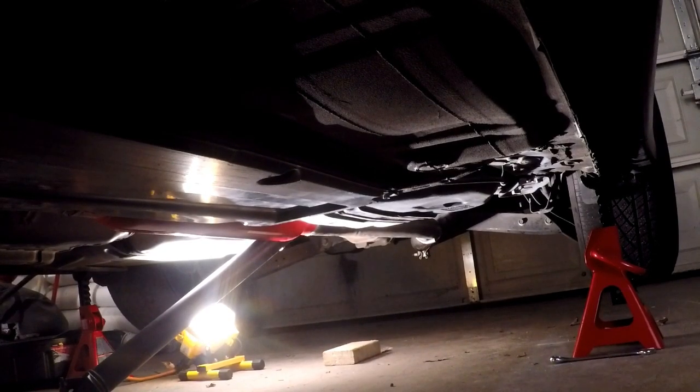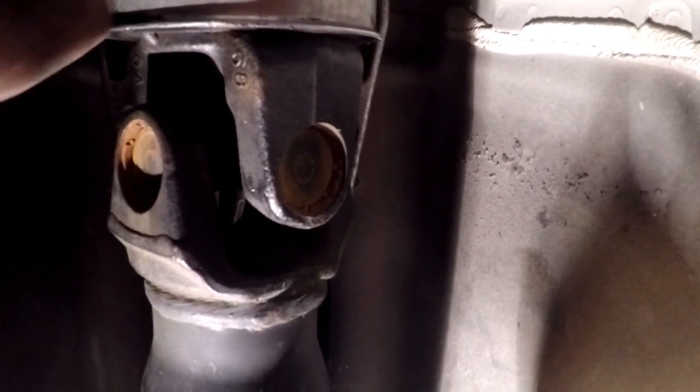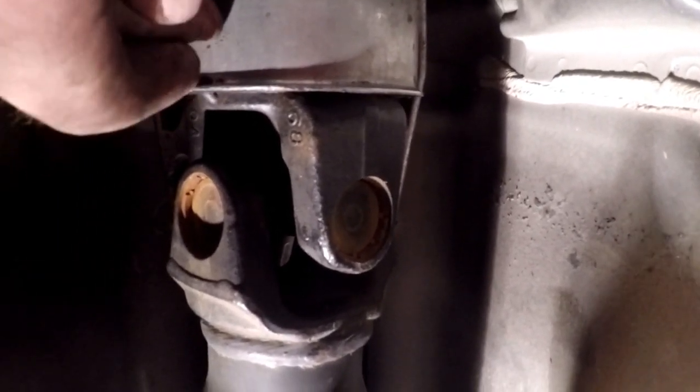So let's get a hold of the drive shaft and get it in, and we'll probably, I guess, refill the transmission with fluid first. So we got the drive line in. It is in fact splined, so be very careful and rotate it slowly till it splines back in. You do not want to mess up the rear seal on the transmission. So we got that back in.